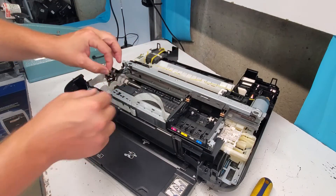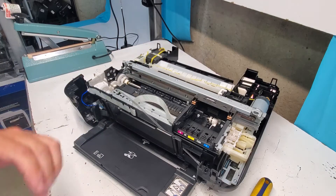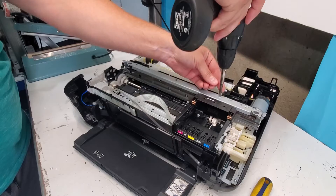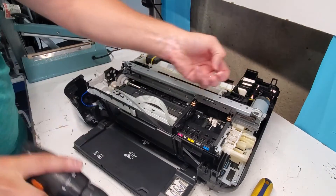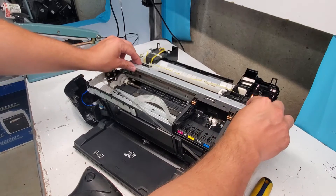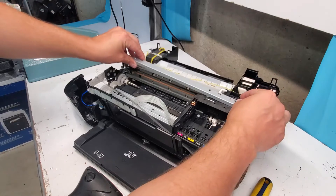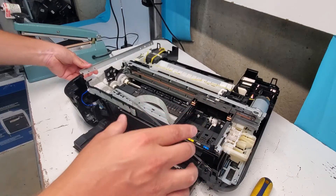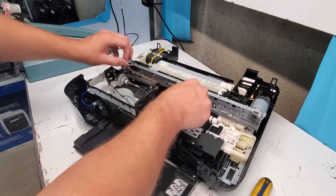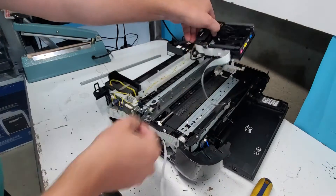Just push the timing strip to the right and ease it out of there. Then we're going to unscrew these. To put the bar back in, just make sure it's in position between these two holes right here — all four holes will line up. The bent portion goes inside here so it holds down the position of the carrier. Now it's pretty much ready to come out. Just disconnect it right here and on this side to get it disconnected from the main board, and it just comes out like that.